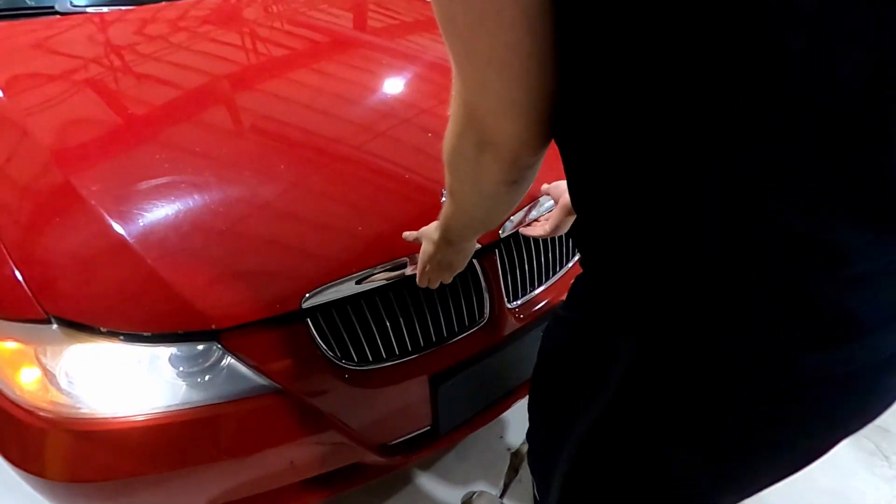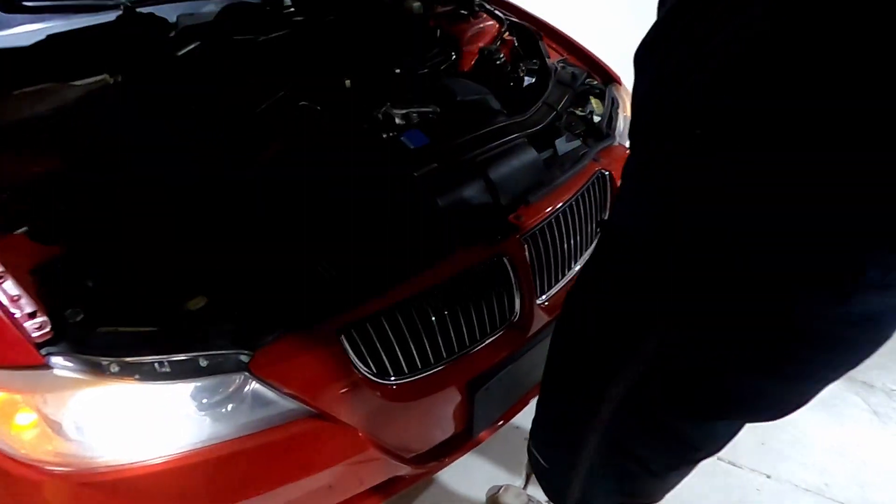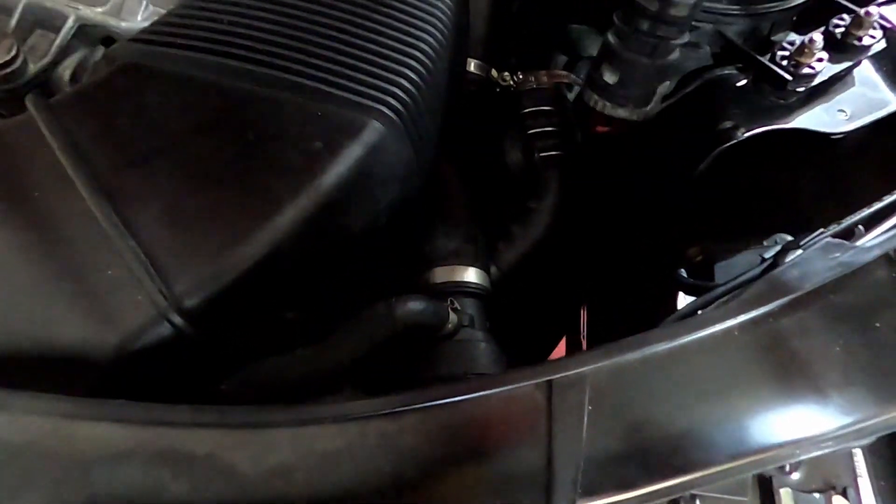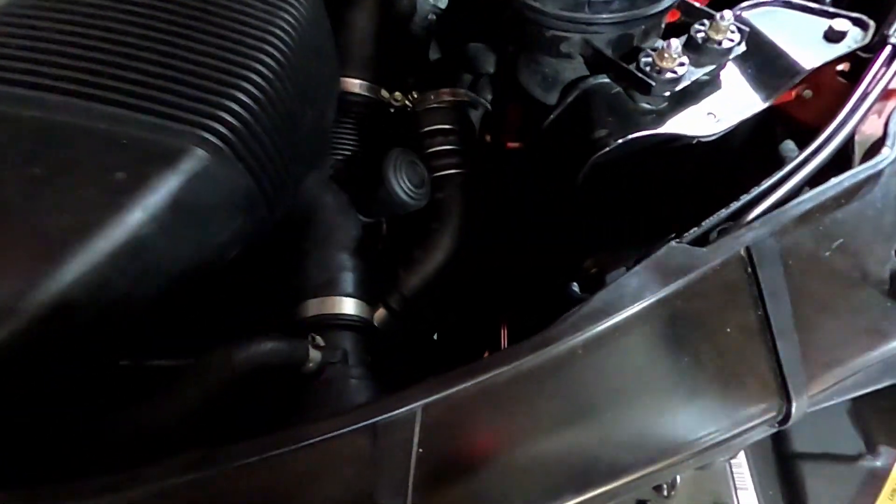I left one hose off — and that's what the noise is. Then we hear a loud noise: what the heck was that? Is that a car breaking? No — it's the charge pipe cracking. Yep, it blew out. That's the issue.